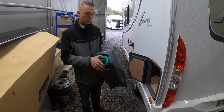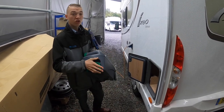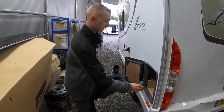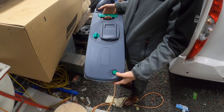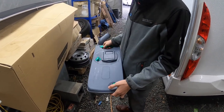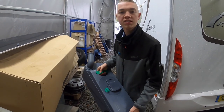Go to your waste disposal point, which is normally behind or beside your shower block or toilet block, and then empty it. Take the cap off, press the green button at the back which allows a bit of air in — it stops it glugging and gives it a consistent flow. Tip it away. Once you've tipped it out, there's normally a tap — put some water in, give it a rinse, and tip out again.